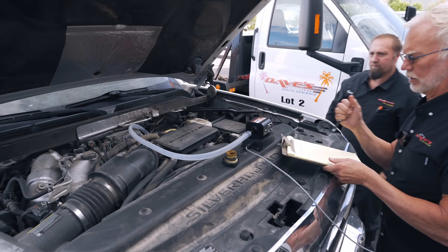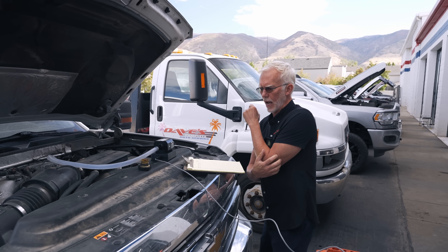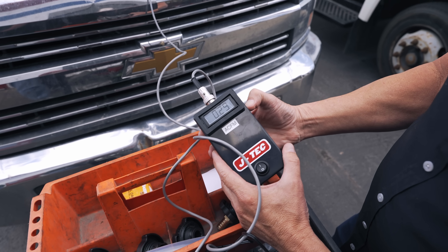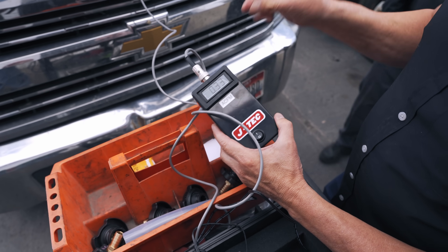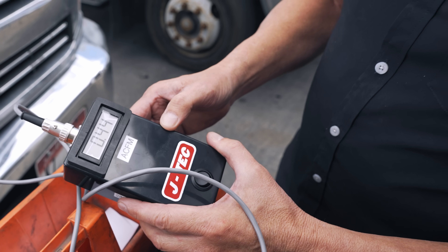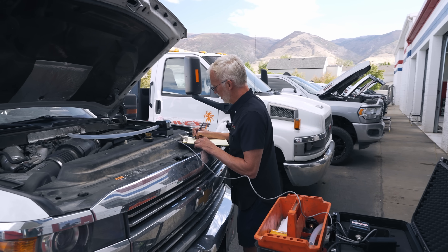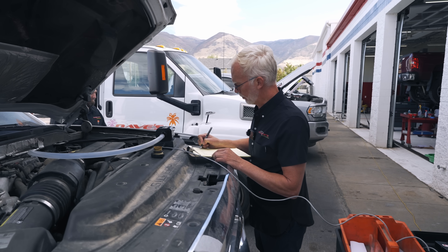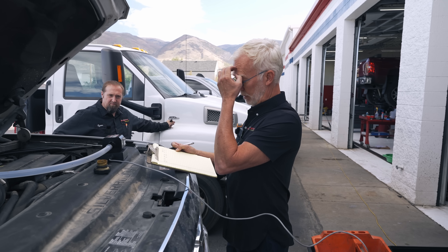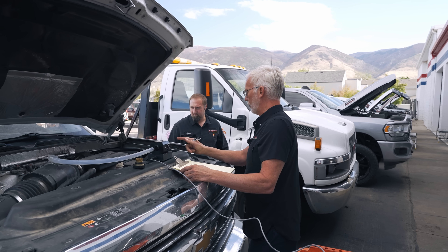Let's go ahead and document how much this one is — 2018, 165K, 3500. Start up cold, just let it idle for a minute. See how much — holy smoke, this thing's hardly got anything. I mean, right off the bat, the other huff-and-puff was like at four. Let's take it up to 1500 and see what we got. Notice that this is good to know — didn't change really, kept the same. We're still at around 0.4. When he goes to idle, we actually go to zero — it's drawing a vacuum on that cold. We're 0.2 at idle and at 1500 we were 0.4. So that one that was huffing and puffing — it's like exponentially a crap ton more.